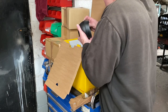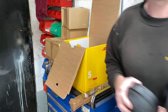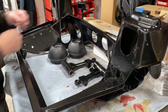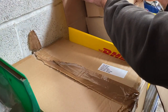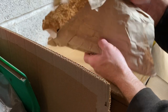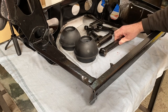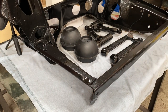These cones I got from Minisport, and they're the standard original type cones. Now I'm more of a Sunday driver, and I'm unlikely to need a performance suspension setup, so hopefully these will be more than adequate. I'd boxed everything up nicely but forgot to label the items within the box, so I ended up having to unwrap everything to find what I needed, but eventually I found the bottom arms. Like the top arms, I'd also given these a good clean and applied a protective coat. These will also need a rebuild kit, which I'd also bought several months back — just something else I needed to find from all these boxes.